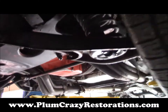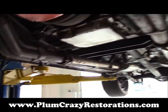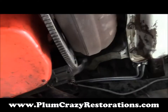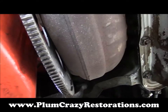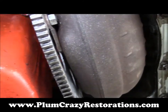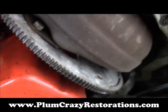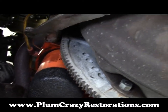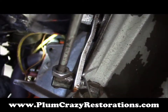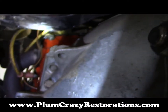Just having a look at the underside of the 1957 Chevy Bel Air. A few things we noticed: the oil pan has some leaking going on around the drain plug as well as the rear seal area. Also, we've got quite a bit of oil coming down from the top — the valve covers seem to be leaking quite a bit.